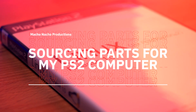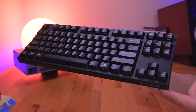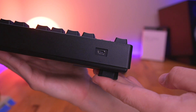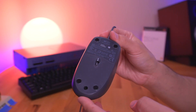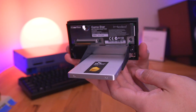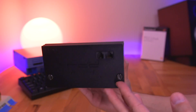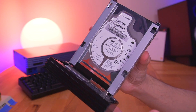Since I don't have the full kit, I need to supplement all the other components with stuff I already have on hand. For the keyboard, I'll be using my wireless ten-keyless Filco mechanical keyboard, which has a USB mini port so I can plug it directly into the PS2. For the mouse, I have a cheap Logitech M100, which is optical rather than ball-driven like the one that came with the original Linux kit. In order to install Linux, we'll also need a hard drive. I actually want to see if we can install it onto an SSD, so I have a 500GB SATA SSD connected to an aftermarket SATA-compatible network adapter. However, Linux for the PS2 can be pretty picky about hardware, so I also have an official Sony network adapter with an official IDE hard drive that came with the North American version of Final Fantasy XI.